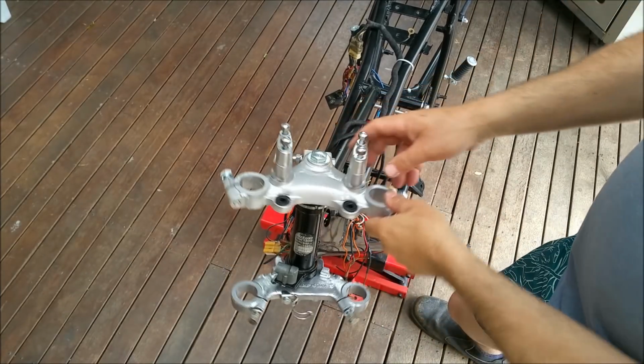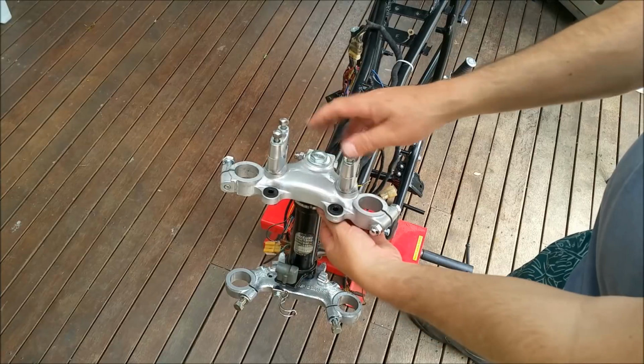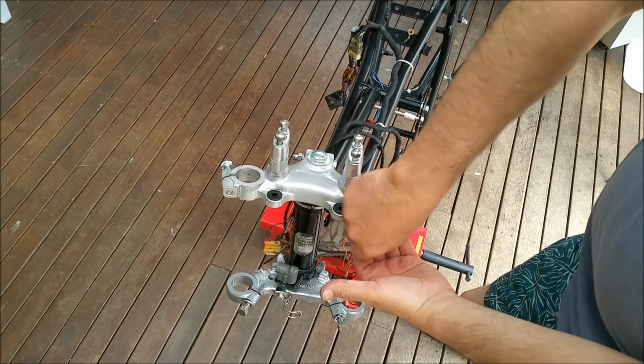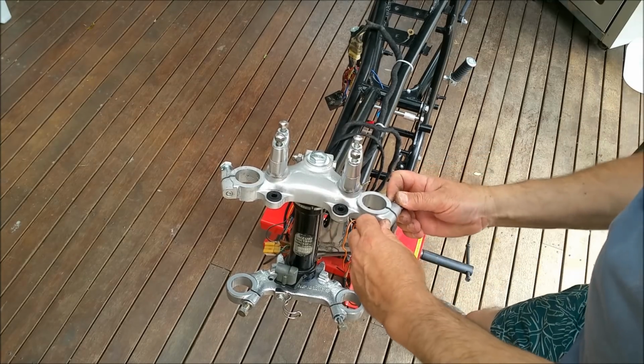The first thing we're going to do is put the handlebars on, because these are sitting there on nuts. Just got to make sure they're true. So I'll clamp the bars in, tighten these things up. There's castellated nuts I've got to put a split pin through. Dome washers for the rear shocks. So I'll put one on the end of these as well. So that's all sitting there.